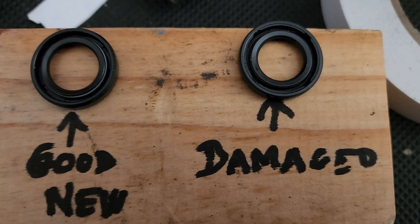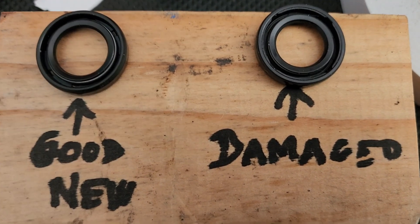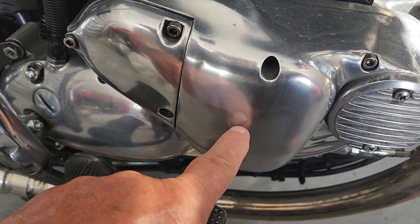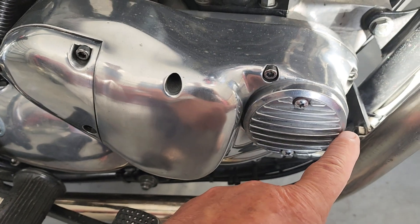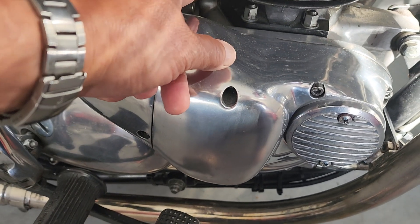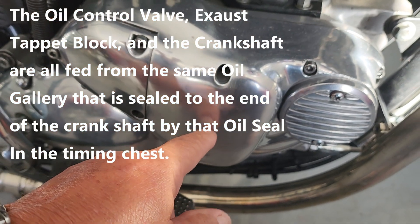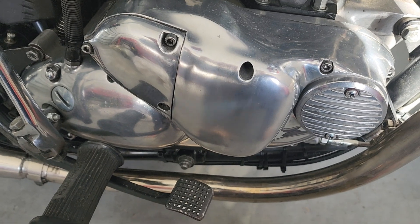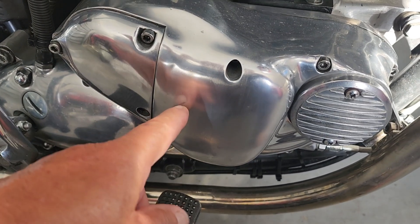Personally I believe keeping your oil pressure down to about 60 PSI maximum is perfect, and that's how I have all my bikes. Now that O-ring is the central distribution point for your oil — one port goes to your oil pressure control valve, one port goes to your crankshaft, and another goes to your tappet blocks. If that oil seal fails, you're not going to get much oil to your engine and tappet blocks — most of it will drain to tank. It's very important that oil seal is in good condition, because oil will squirt around the end of the crankshaft straight into your timing chest.